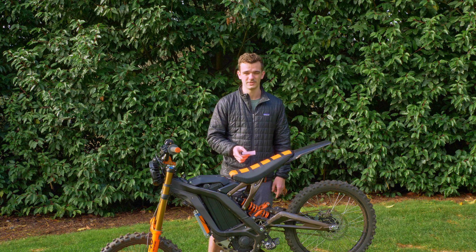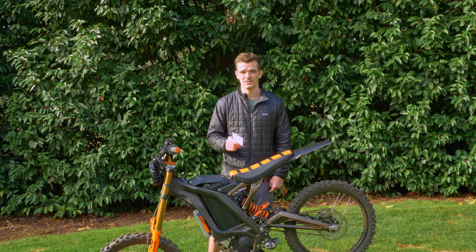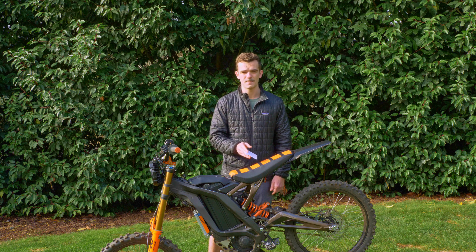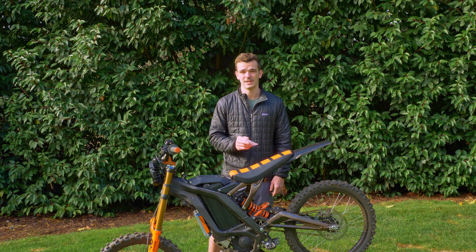For some non-scientific range results: Cole and I went to Agnes, Oregon a couple of videos back to do some riding and testing on these controllers. Even though Cole was riding with a larger tooth sprocket and weighs less, over the course of an hour-long ride I ended up with about 5% more battery than he did — me on the ASI controller, him running stock. Also worth noting: we used one battery per bike throughout the entire test without recharging. So these results represent a worst-case scenario, as we started with the stock controller at the highest charge and the bypass battery with the ASI controller was at the lowest. If you replicate these tests with every setup at 100%, you should see a higher margin of increase in acceleration and top speed.